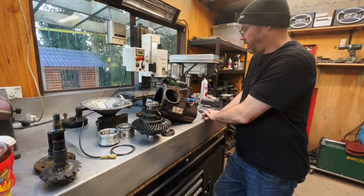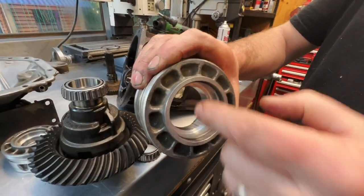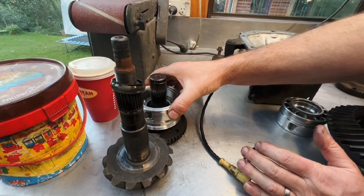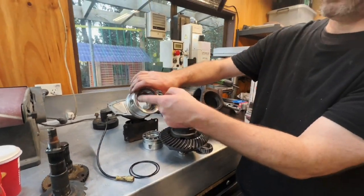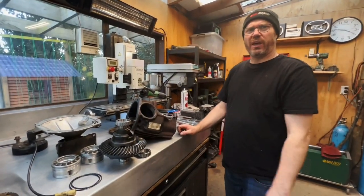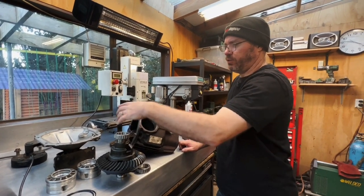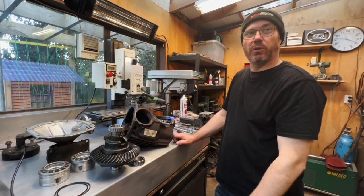We've got 75% or something. There's a couple of needle roller bearings that go in here that support the shafts, these ones. This goes in here like this, and there's a needle roller that runs in there to support the shaft, as well as the diff carrier being supported by these bearings here, which is an interesting way to do it. Why not? Nissan don't do that. No. Nissan have a tight fit between that shaft and the inside of here to support those shafts. Seems to work. People break them, but it works.